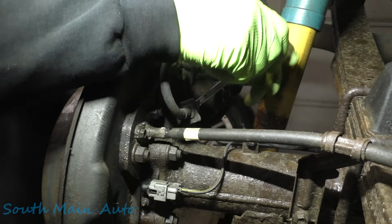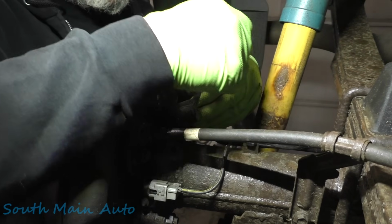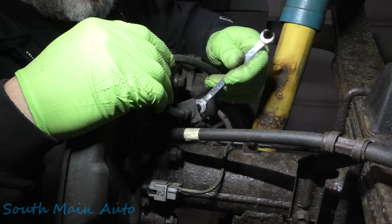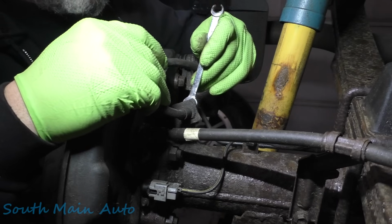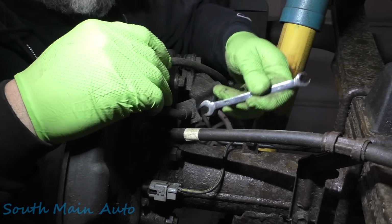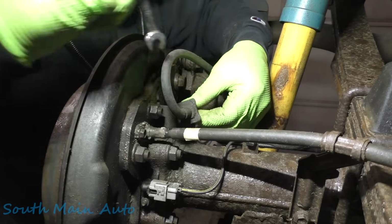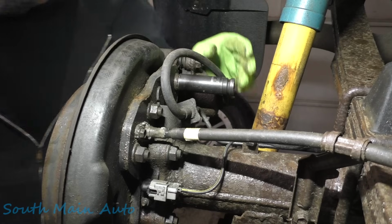We're gonna see if we can't crack our brake line loose. Guess we ought to use the flare nut side of it, or the flare wrench side. All right, there we go. Crack that baby loose. Not too often you can do that on a 2012 New York truck. I believe this truck's been crowned or fluid filmed a few times in the past. Not consistently every year with this fella, but at some point in the past, it has been a couple times at least, which has preserved it. All right, take that off all the way. Yeah, it is a 17.